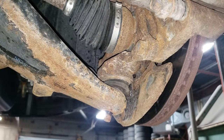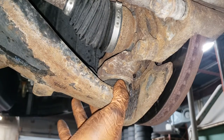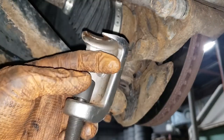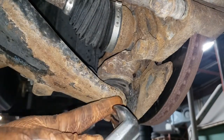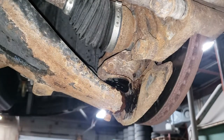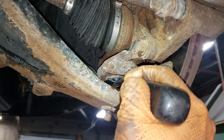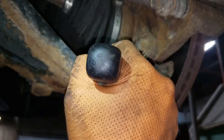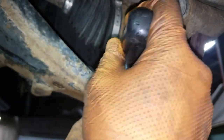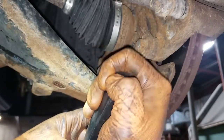There are a couple of different tools you can use. There is a tie rod puller I like to use when there's more of a control arm to grip, but there's not really much to grip here. The second type of tool — which is the one I usually use — is this ball joint separator. The only problem is it likes to go around the ball joint boot, so I want to lubricate that boot first so I don't tear it. Sneak it into place by gently getting in between the boot and the control arm with a flat screwdriver and pry up just a bit.